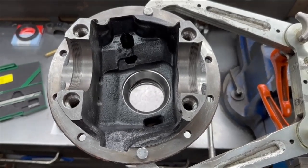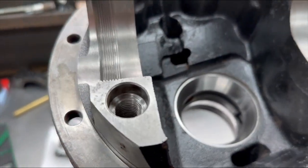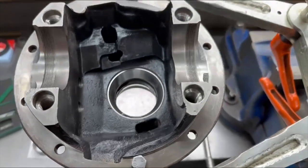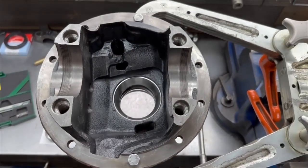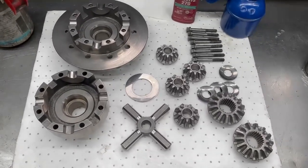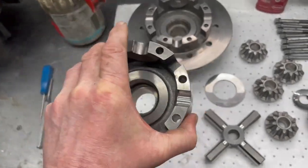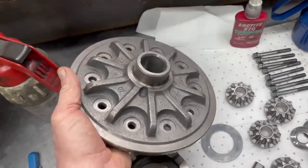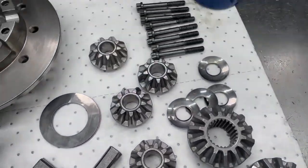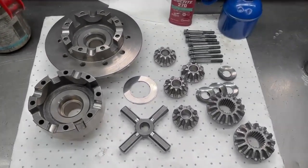This is now going to be a build-up of everything we can do to a short nose diff to make it stronger. We've got a colleted case with the collets back in. We have it pegged with our own conversion on the outside, cleaned up and ready for a build. We've got a decent centre that's been through our polishing machine — nice and clean, shiny and rust free. We've got repolished shims, our one-piece forged cross shaft, all the gears through the polisher, all new bolts, and the thrusts through the polisher. Everything is as clean as we can get it, and we're going to build a heavy duty centre.